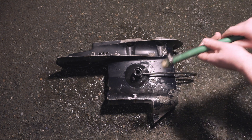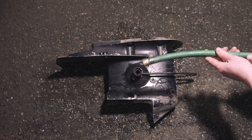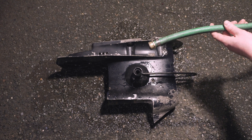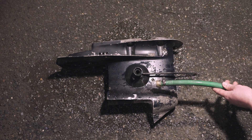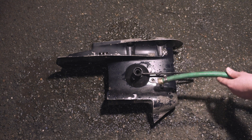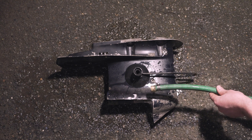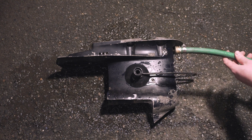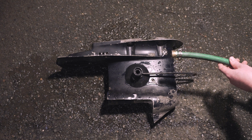The first, simple one: don't run the hose too hard. Just turn on the water and let it run, because the engine itself will suck up the water. There is no need to put the hose on high and have it shoot into the engine with a lot of force. You basically just want to turn it on so it's lightly running, and the engine will suck up the water itself.